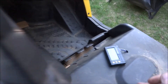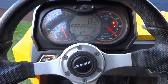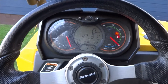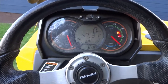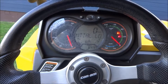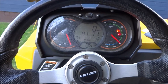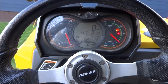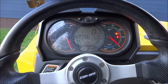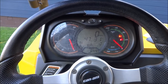At this point I'll probably charge up the batteries to be able to use it again. It'd be good if I could ride it all the way down to zero, but it's getting late now so I'm going to call it a day. Also, what I'd like to do in the future — I've ordered low voltage alarms, five of them, so I can put one on each group of batteries on the balance wires. That way I'll hear an alarm if the batteries get too low and I'll prevent causing damage.